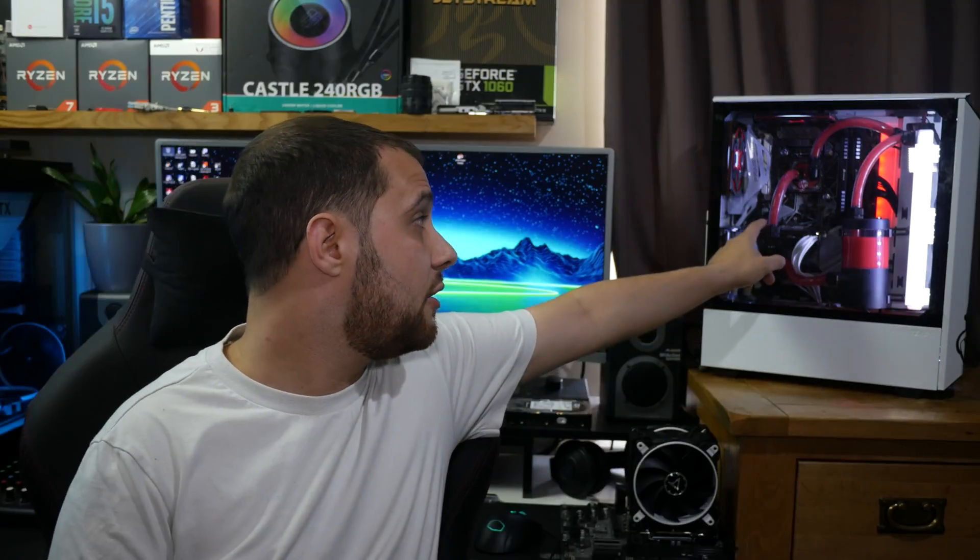It didn't go perfectly. There are a couple of problems — first thing was just me. This being my first time doing water cooling: the tubing — just get the tubing wet. It goes on really easily. I was worried I was going to break the PCIe slot at some point but you just get them wet and they slip on fine. You also don't have to tighten compression fittings all the way — just get them tight and then give them another half turn. You really don't need more than that.